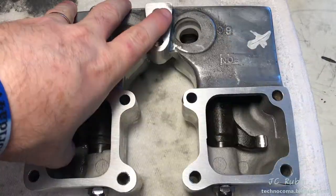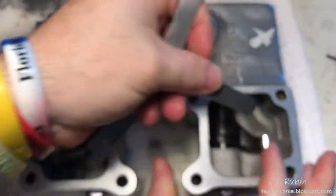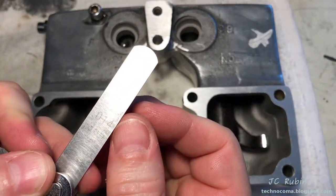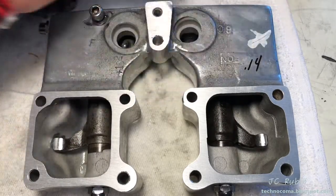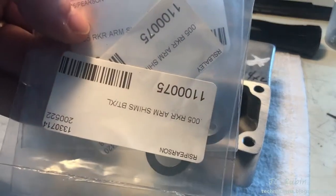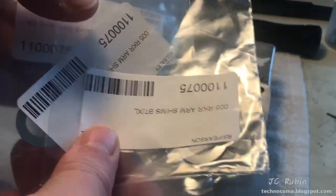I check the first rocker arm on the second box — it moves freely and the measurement is 14 thousandths of an inch. The second rocker arm has a tight pull at 10 thousandths of an inch. Knowing that there needs to be four thousandths clearance on both sides, I make these annotations. The shims have arrived, so we're going to disassemble the boxes, scrub them thoroughly, put the shims in, and reassemble.